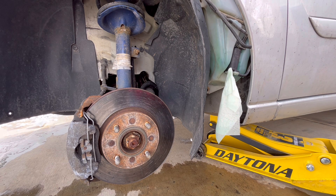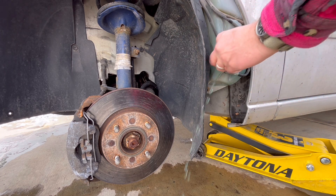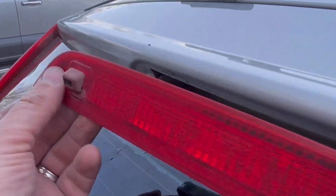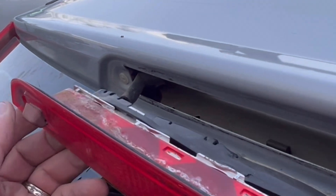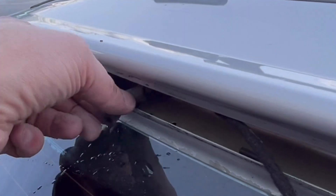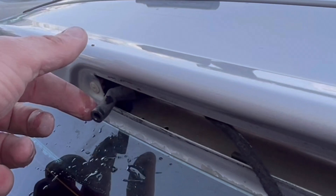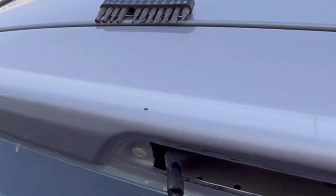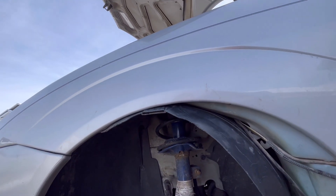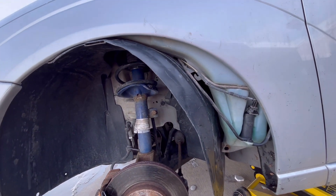Maybe from driving it and being in the sun a little bit more today that might fix with time, and now that I've got some 20-below cleaner in here, it could get refilled if it unclogged — not a big deal. I'm just going to take this little plug out, make sure, and plug that back in. What I ended up doing is taking off this light — it's got a built-in nozzle into the light assembly in the third tail light. There's a little bit of water in here and I think it's just frozen up inside there.